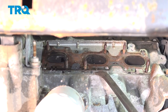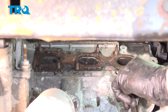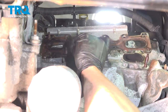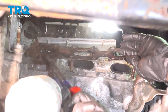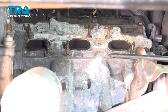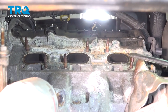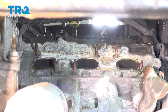Let's make our way back over to the engine and remove the gasket — gently pry it out of place using a small pry bar. Once you have the gasket out, pay attention to the engine. It's common to remove the manifold studs when doing the manifold. If you don't have brand new studs and these still look in good condition, you can leave them, then continue with a sanding block and some fine sandpaper to sand down the area of the engine where the brand new manifold will ride.